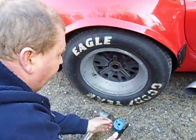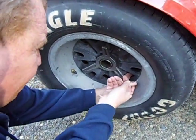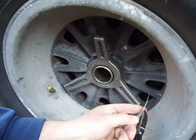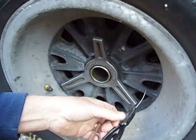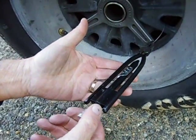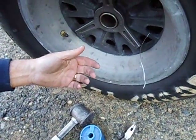We're going to peel out a length of safety wire, keeping it turning in the direction of tightening, and wrap it around a spoke on the wheel — as you can see, pulling it towards the back at the top. The safety wire pliers are placed close to where you want it to finish up; you can see the end of the spoke and the hole through it. To operate the safety wire pliers, squeeze the handles together, pull the lock back in place, then pull the knob on the end to put twists in the wire. There's aircraft spec on this — how many turns per inch and that sort of thing.